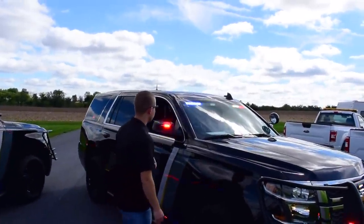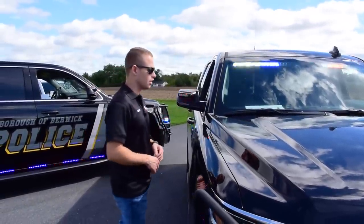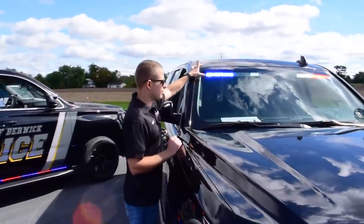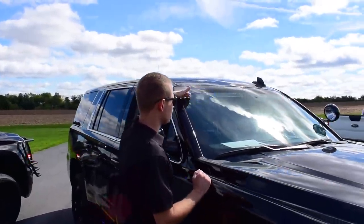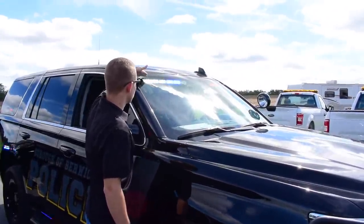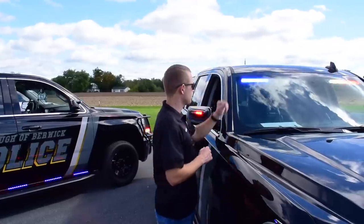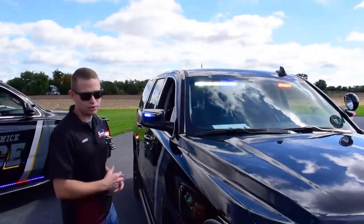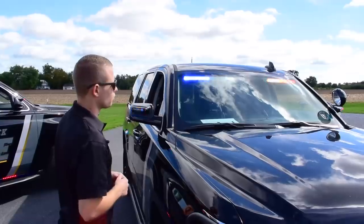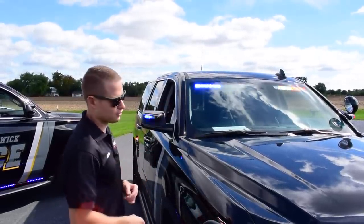Coming up here, we have Whelen's FST. It's a newer product where Whelen has improved their design and maximized the available space. Instead of coming down further in the window, they've kept the lower line the same but utilized more space above it. So you're not losing any visibility but gaining much more light output. This is Whelen's newer technology with silicone behind the lens. The inner edge is the Duo FST — red-white, blue-white warning, red-blue warning, override to full-white flood, and takedowns in the center for added punch.